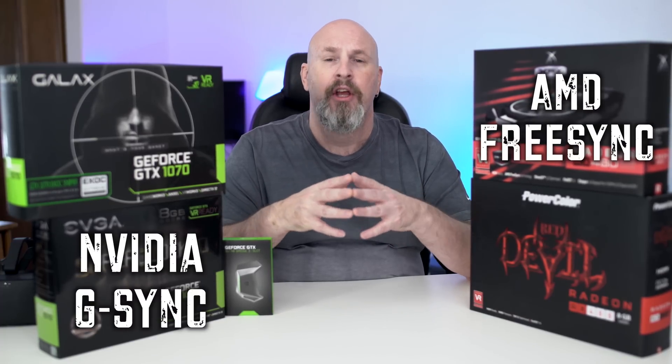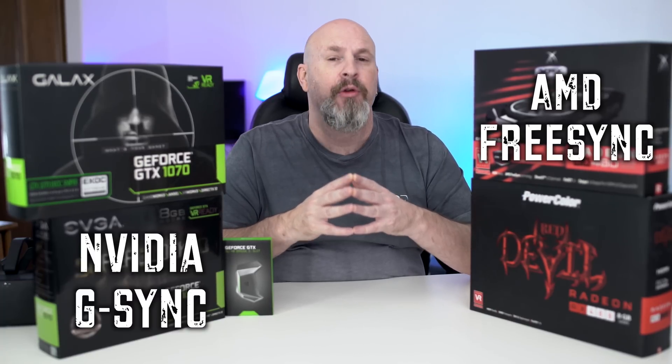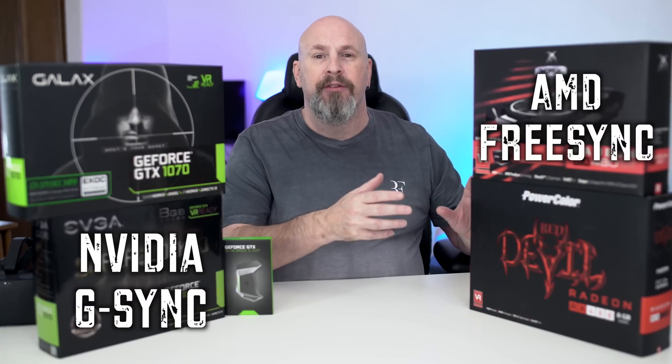Just be careful with overclocking, because I've found that when overclocking cards in SLI or Crossfire, that's really when you start getting a lot of glitches — the technology is kind of already pushed to the bleeding edge. Another thing is stuttering and screen tearing. They now have FreeSync and G-Sync technology, so if you get a monitor of that caliber, you won't have to worry about those issues at all. All those problems are eliminated — same thing on the AMD side.